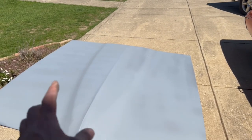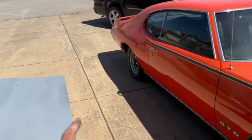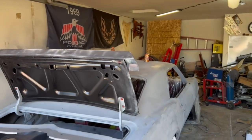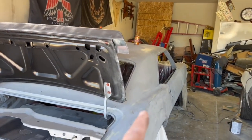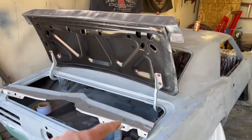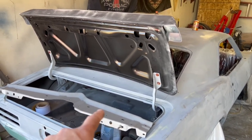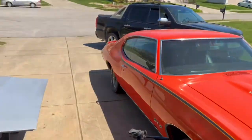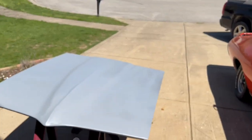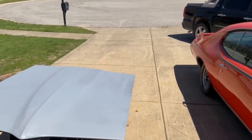We'll go ahead and put it back on the Great Pumpkin for safekeeping. We know it needs a little bit of bodywork, so back to the bodywork stage. We're making great progress. The next thing I've got to sandblast is the front bumper support, so I'm going to get that going. But this is just a matter of opinion — I do this all the time: sandblast, only blow it off, go directly to primer. Some people say it doesn't work.